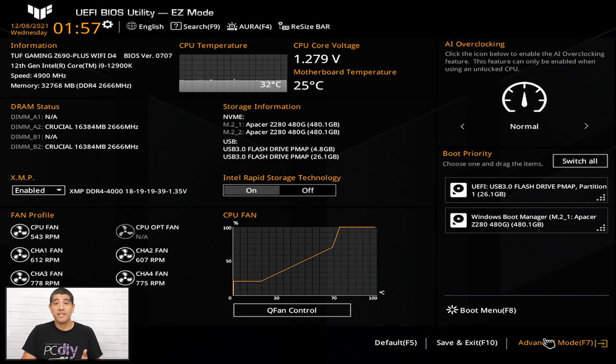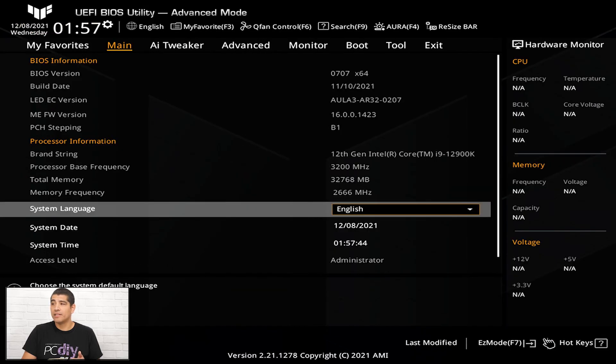Lastly there's F7 — you can click it or press the F7 key. This enters the advanced portion of the UEFI, giving you more extensive specialized features, functions, and options within the UEFI firmware environment. To return back to the easy mode environment, simply use the F7 option again.